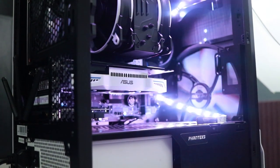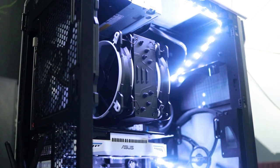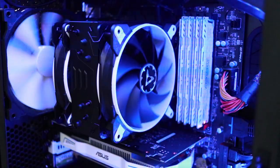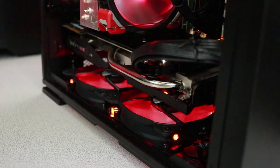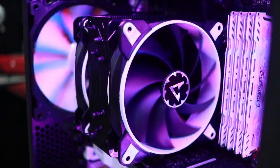Part of this shows how much good airflow can impact the cooling of your components. That NZXT 301 sucks in air from the bottom and it goes right into the GPU, so your CPU is kind of getting that leftover hot air that works its way around the GPU — it can only really get so cold in that confined space. Whereas the Enthoo Evolve Micro ATX case that we used has a giant 200mm fan in the front that pushes a lot of air over the cooler and right out the back.